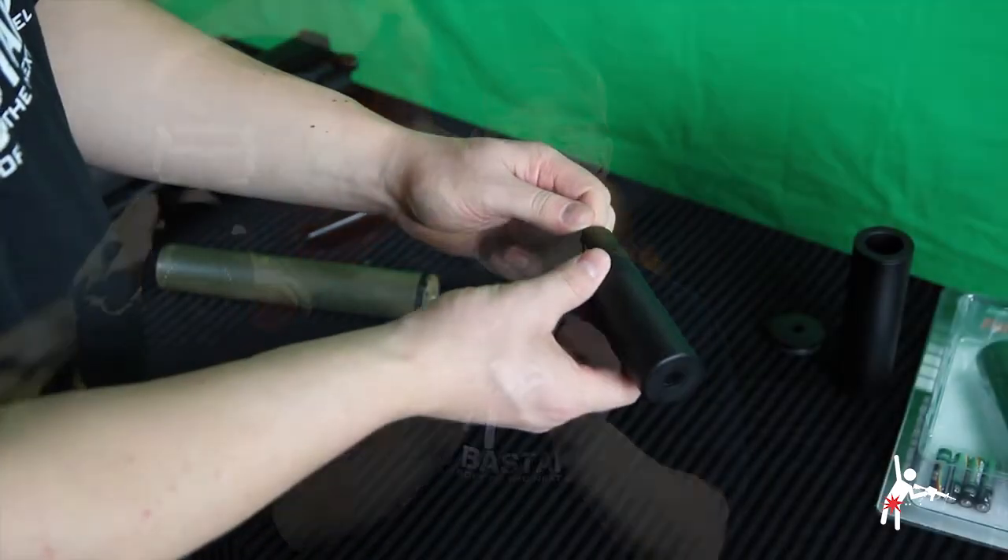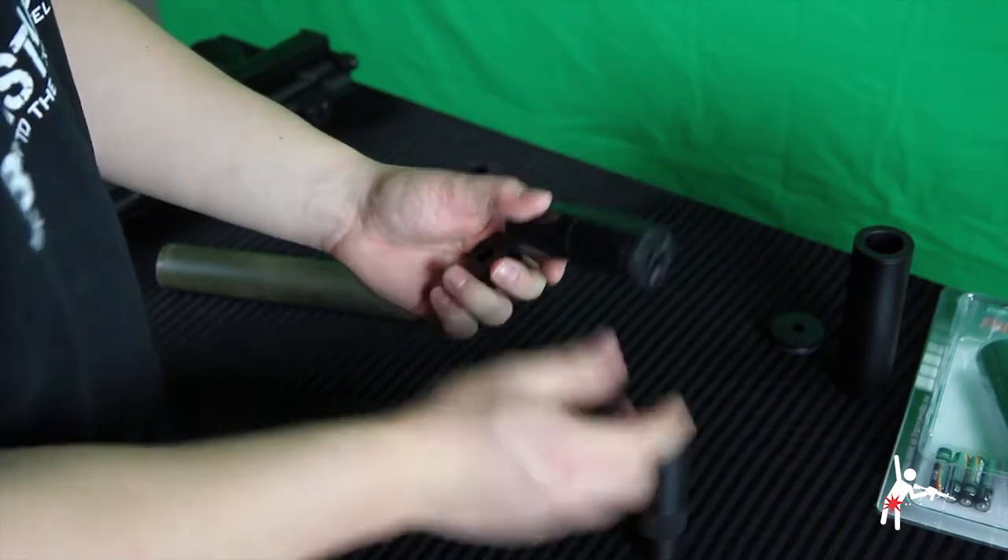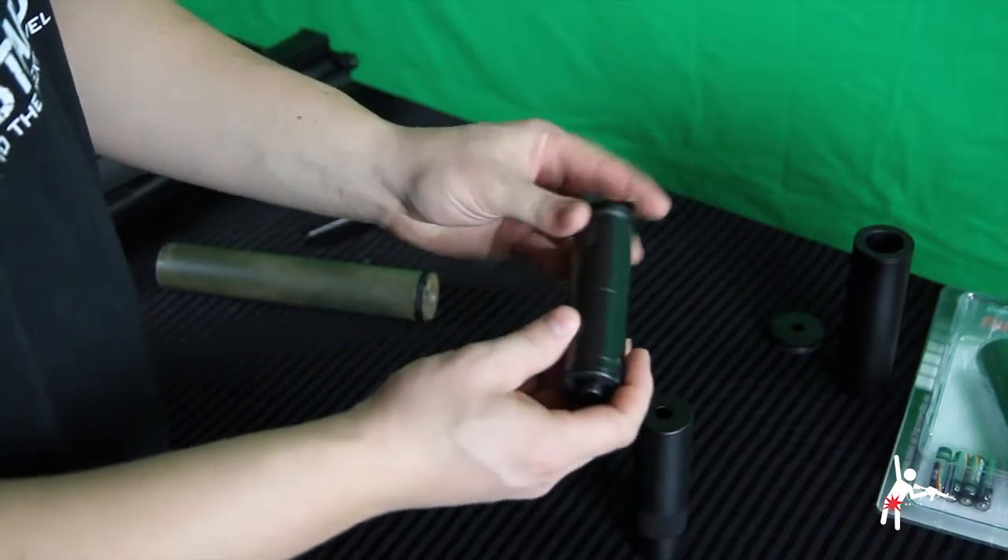Very easy to take down — you unscrew the cap, the whole module will come out just like this with the cap attached. What you've got to do is unscrew six screws, take the whole unit apart, and then there are three more screws that actually detach it from the end cap. What you're left with is the entire module — take out your batteries from this end, switches on this end, very simple.